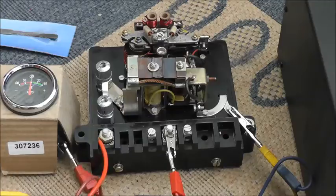That clunk is the contact closing and connecting the battery to the dynamo. A common fault with these boxes is for certain contact pairs on the voltage and current regulator to fur up, and this seems to happen when the boxes are left for any period of time without being used. What happens is that those contacts fur up to the point that in their normally closed condition they cease to conduct, and then the whole box stops working.